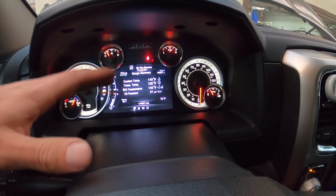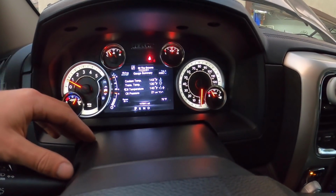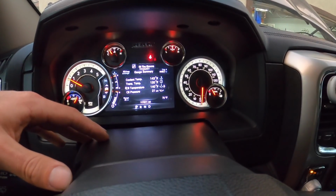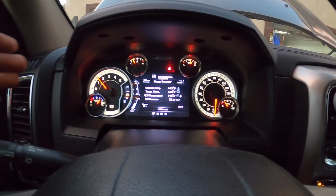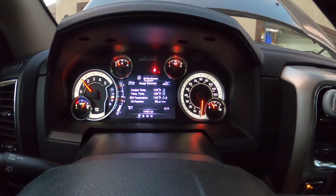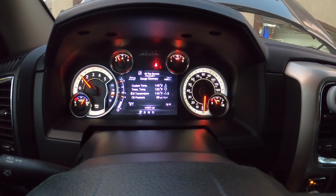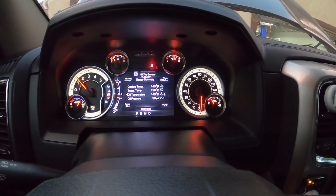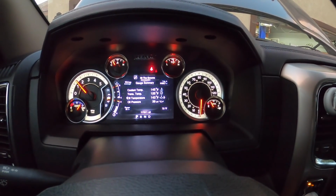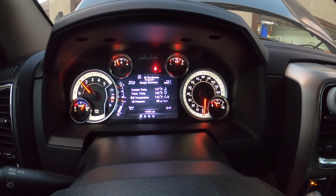And I just read a comment from the previous video showing you guys the actual truck itself, and somebody else also mentioned that the oil pressure switch is known to go bad as well. So fingers crossed, boys, we'll see. But even as I hold the RPM, it doesn't sound terrible. I'm just trying to build a little bit of heat in this motor since it's taken forever, but you can see there, maybe 1400 RPM. We're sitting at 39 PSI, so definitely good oil pressure everywhere else. We're almost at 150 degrees for coolant temp.